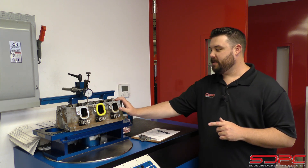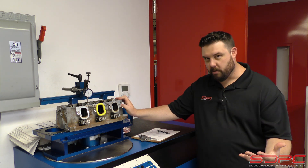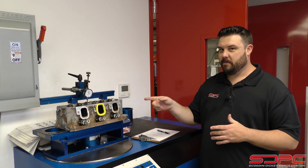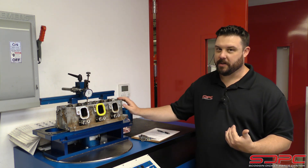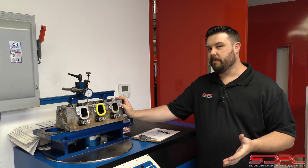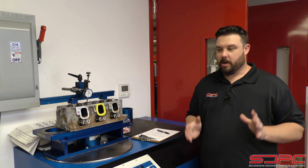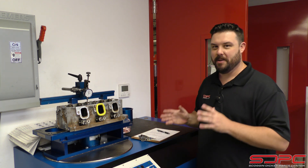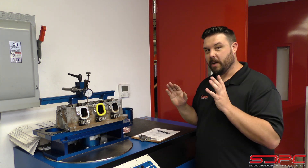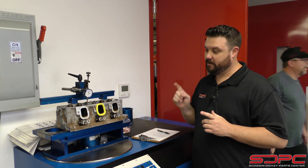One of the things is I've measured both the intake and exhaust ports in terms of CCs and the combustion chamber, and they match what GM advertises for the 5.3 liter, like an L83 in the same year model trucks. The valves, valve springs, stuff like that — they're the same part numbers as the catalog. But people keep asking, well, how much do these flow? I keep telling customers you need to be looking at whatever a stock 5.3 head flows for the L83 Gen 5 based engines, but I've yet to verify that. So these guys were able to show me how to run this thing without breaking it. This is our Super Flow cylinder head bench flow tester, and with a little bit of help they're going to show me how to run it. We're going to get some numbers on this thing and maybe be able to help you guys pick some more performance parts in the future. So it's about to get loud — let's get to it.